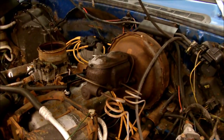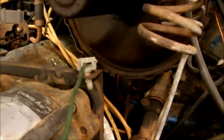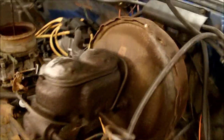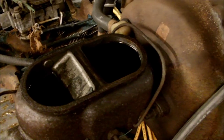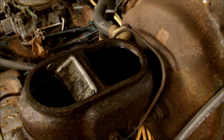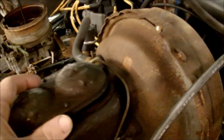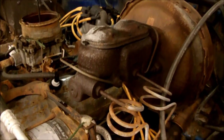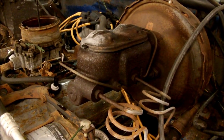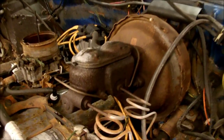When I bought the truck it had no brakes and the guy told me he assumed that a line blew out. Well I finally got to looking at it and it might be hard to see on camera, but the underside of that booster there is damp. Upon further inspection I finally got to pop the cap. The fluid really isn't low. Like if a line blew out there would be no fluid in here at all. I pulled this off a trailer — he never added fluid to it. I pulled it in the garage yesterday and it's still holding some fluid. So I think to start I'm going to change the master cylinder and see what happens. I'm still going to pull the rear wheels off and see if anything happened in there like a wheel cylinder or something. But I definitely think this master cylinder is garbage to start.